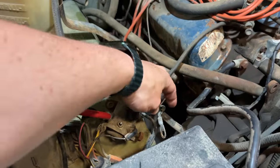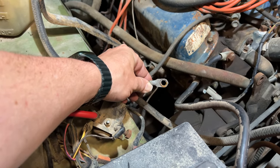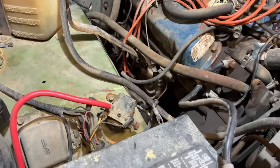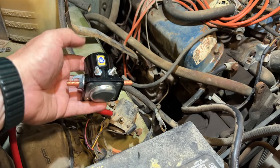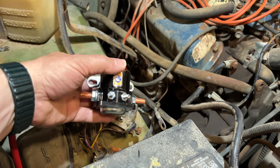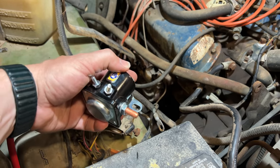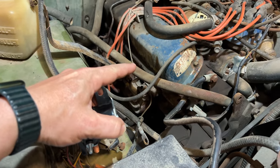Last time I connected battery power to this wire which runs down to the starter, and the starter was completely shorted out, which I think has ruined the starter solenoid. I do have a brand new solenoid to put in, but if I were to put that in right now and tried to start it, the old shorted-out starter is going to ruin this solenoid as well. So I need to start with the starter, then replace the solenoid, and then we should be able to turn the engine over.